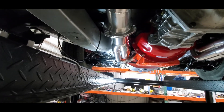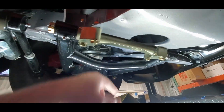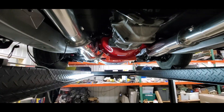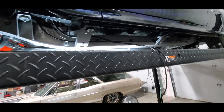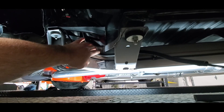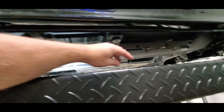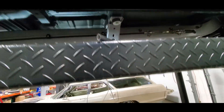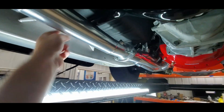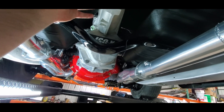One of the things we're definitely going to do while the car is here is raise the front end — it's sitting a little too low. I've been working back on the transmission. I'm not normally a fan of convoluted loom, but I think it's the right product for this location, although we're going to transition to heat-proof sleeving because of this exhaust tube right here. We're going to wind up bringing those wires across, though we're not actually using this particular wire.